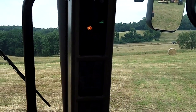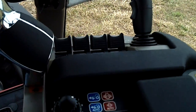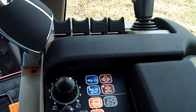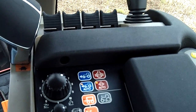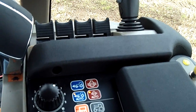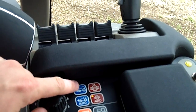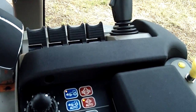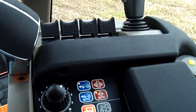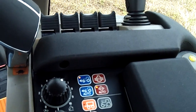The benefit to this, especially for diff lock, is that I don't have to re-engage the diff lock every time I want it. Anytime I know my steering wheel is straight, I have diff lock engaged. Now, for four-wheel drive, in a muddy situation I would typically run four-wheel drive full-time, because I do not want the four-wheel drive to kick out, but I may want my diff lock when my steering wheel is straight.